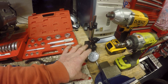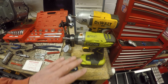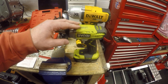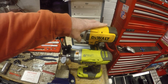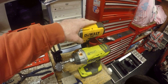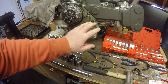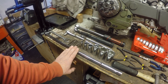A magnetic stand and a dial gauge for measuring end float and play when you're calculating crankshaft and gearbox shaft clearances at engine build stage. A low-torque impact driver for driving nuts and bolts in and out that have a low torque fitting or that you're taking repeatedly in and out, just to make your job a bit easier. And then the big DeWalt — a 1000 Newton metre gun — which I tend to run on the mid setting, about 450 Newton metres, to shift any stubborn nut or bolt, primarily for the clutch, primary drive gear, and alternator nut.